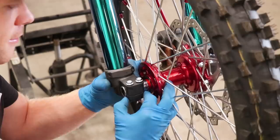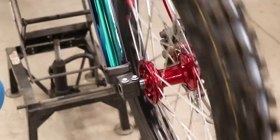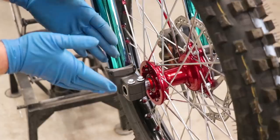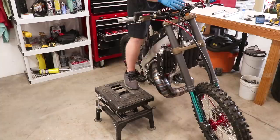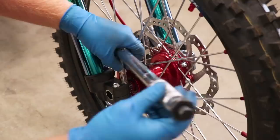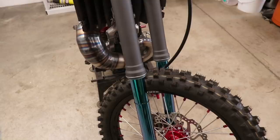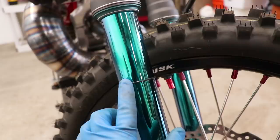Come over to this side and make sure the fork is free on the axle. There are two different ways to align the forks and wheel. The first is to spin the wheel and then grab the brake — that'll bring the forks into proper alignment naturally. The other way is to take the bike off the stand and compress the suspension, which will also naturally align the forks. It's super important to have your forks aligned; if misaligned, you'll cause wear on the lower tubes and suspension won't be smooth. Having an o-ring on the lower fork will show you how much the suspension is compressing so you can tune accordingly.